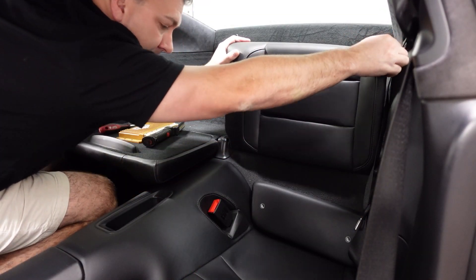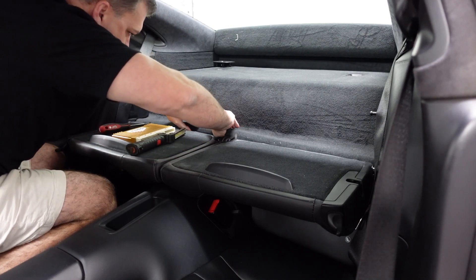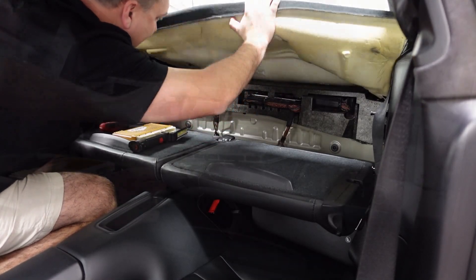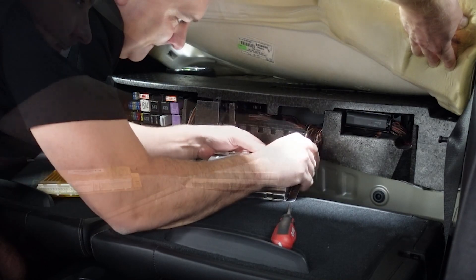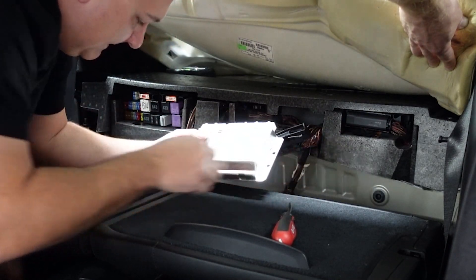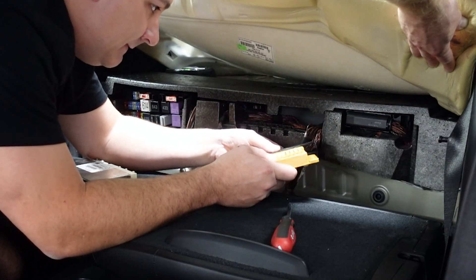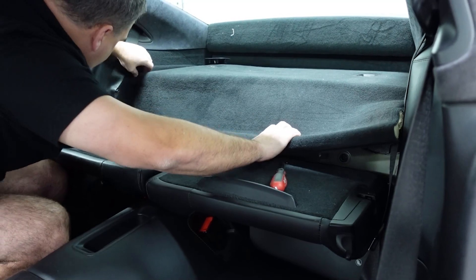Install on the back of this 991 is pretty easy — just lower the seats, lift up on the carpet and pull it away. Then you'll locate the OEM suspension module, pull that out, and take these two releases off. The larger release you might need to use a flathead just to pry it loose — it's a little stubborn. Then just plug the DSC module in the same way the OEM one came out, put the carpet back together, and you're good to go.